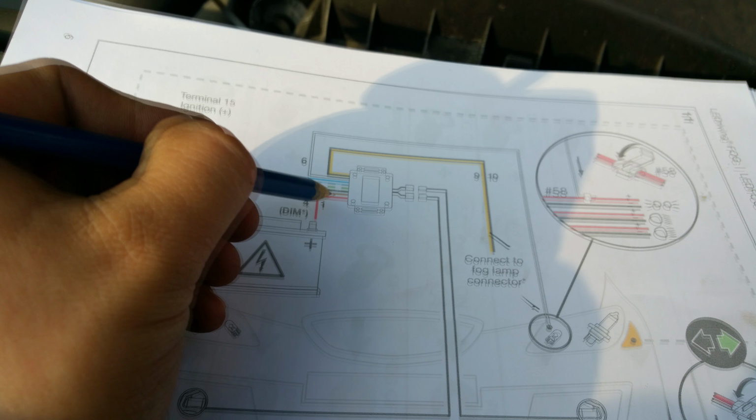Right, what you want to do as well, you want to go over to the other side and undo that headlight, and you've got to find the indicator wire for that as well. And it's one of the 2 wires again. So whichever one this grey wire went to, can't remember which one it was, pin 7 or 8, the green one needs to go to the same pin. So you need to wire up to that. Now the wire on this just follows underneath the bulkhead around the radiator, and it just cable ties every now and then. In fact, you can see the green wire.